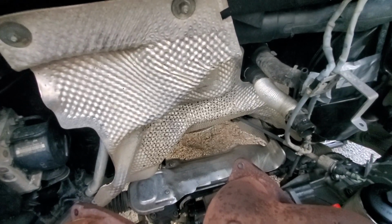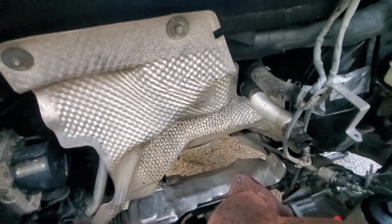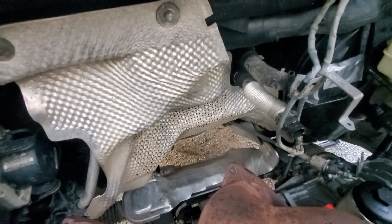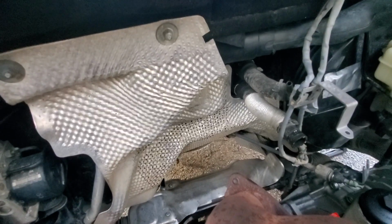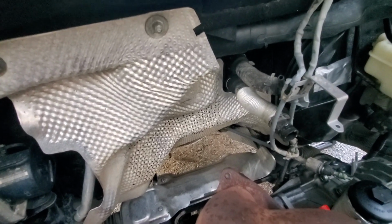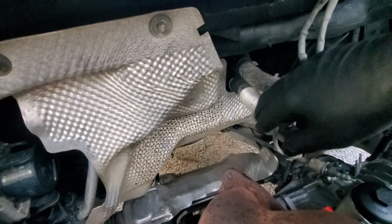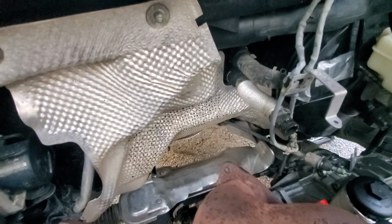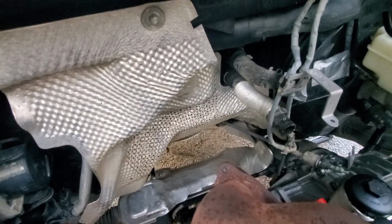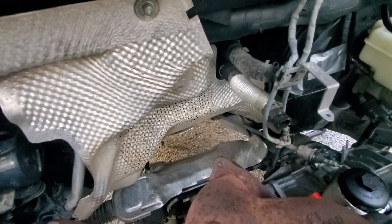All that can melt up, and this could be a disaster for other cars that are running their cars very hard with a hot turbo placed back here if you don't have the proper shielding. And especially if you're generating big horsepower, you're going to be producing a lot more heat. So for example, if these melt off, you're going to have a major coolant leak. It's going to spring a leak, which could definitely set your car on fire. Spring a leak, you can blow your engine.